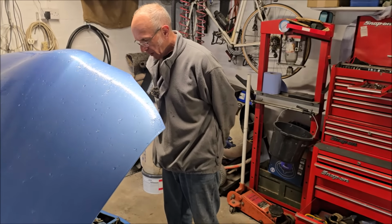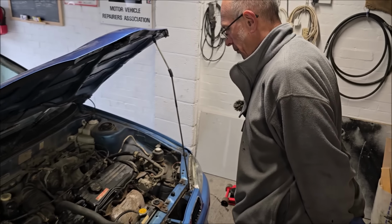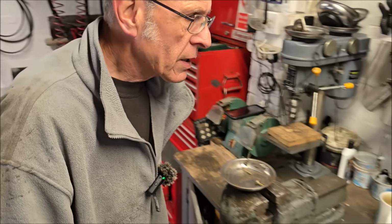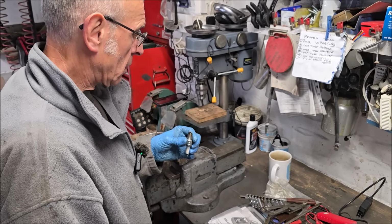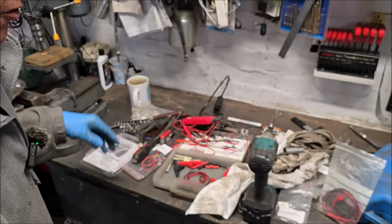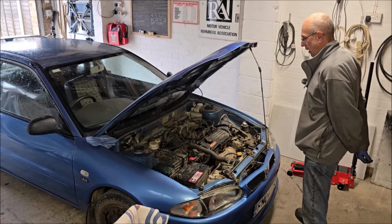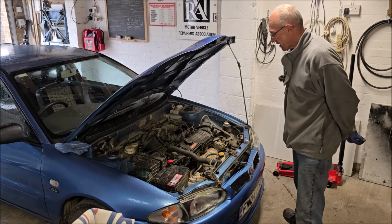So we've retreated into the garage. And, well, we're a little bit wiser, but none the wiser as to what's going on. Just talk us through what we've achieved. Well, this here has been running bad on cylinder 1. The cylinder was washed and we had no compression, because there's fuel flooding in there and not burning. Plug leads are okay. The valve clearances are okay. But it's still not right. It's weak on that number 1 cylinder.